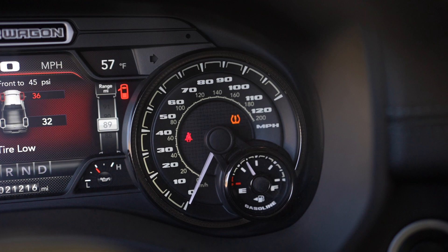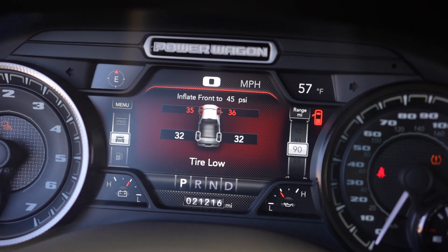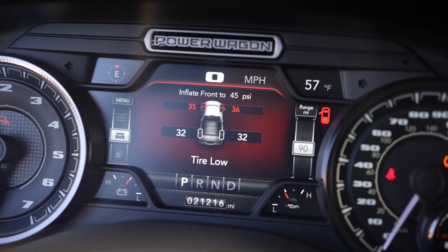It's a good possibility that dropping pressures below factory will trigger a TPMS warning light, unless your truck is a Ram 3500 — but Ram 2500s, Power Wagons, and Fords will likely get lights. Nothing to be worried about — this is easily corrected. If it's a Ram, you can use AV Pro Cal available on our website, or a software application called Alpha OBD. If your truck is a Ford, you can use a software application called FORScan, spelled F-O-R-S-C-A-N. There are instructions online for how to operate it, so it's not the end of the world. There's no single exact pressure recommendation, and that is the beauty of the chalk line test — every result will be different and you're fine-tuning the pressure to your exact truck and exact load. Feel free to reach out via phone or email and we're happy to help you dial in your build.